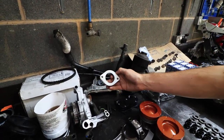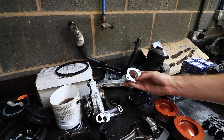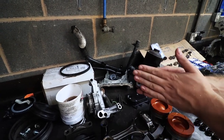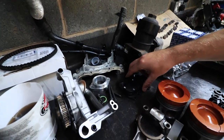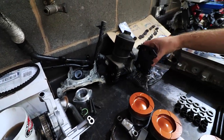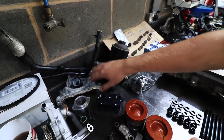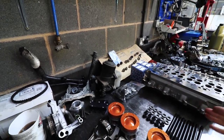This part here is just something we've put on to replace the thermostat because we're going for the electric water pump, so we need to weld a barb on there to suit the outlet — but that's for later on. Oil cooler outlet — that's going to replace the existing one so we can send the oil cooler straight out. Then just a factory pipe; some will get used, some will get modified, but we'll work that out as we go.